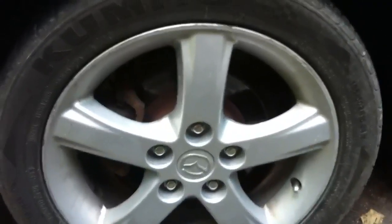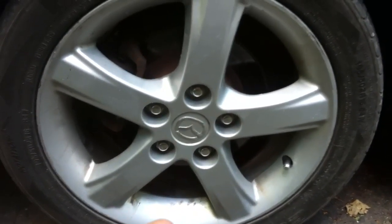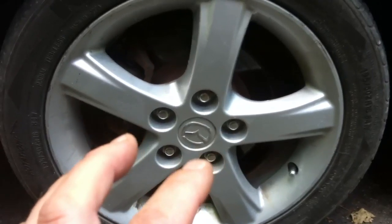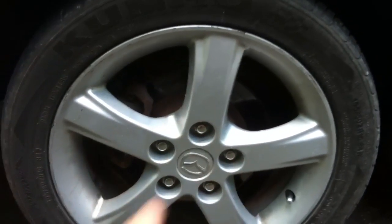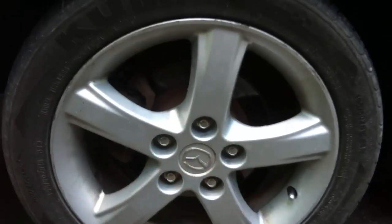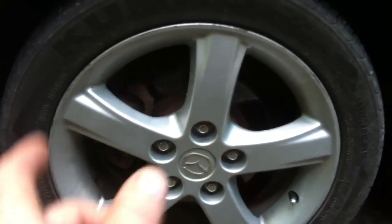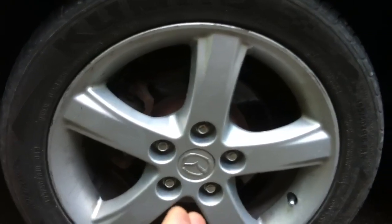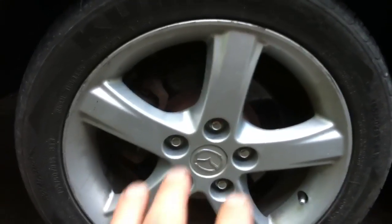You could also just have a bad wheel speed sensor. Another cause is letting your brake pads wear down too much — metallic brake pads shed fine metallic dust and small chunks that get attracted into the wheel speed sensor, which has a magnet inside. The sensor works by measuring little teeth on the hub, similar to a bicycle sprocket. As the teeth spin past, each tooth pulls the magnet in and then releases it, counting revolutions to determine if one wheel is spinning faster than another.